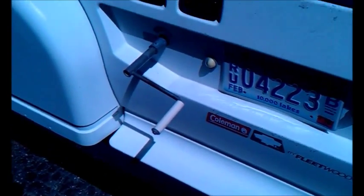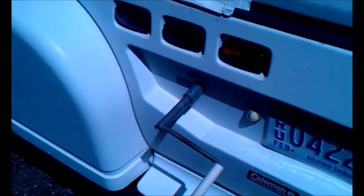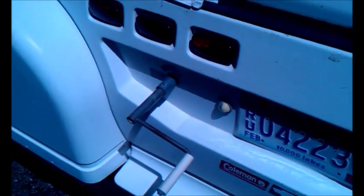One thing I did notice is when it gets down to the bottom, it will click right away. The drive shaft or the extension tube isn't backing off. It should have at least 2 or 3 turns before you hear the clicking when you use it from the bottom to when you start raising it. So what I'm going to do is pull off the bottom plate, take a look at the wiffle tree and the chain connection, and probably get a pipe wrench to get that extension tube off.